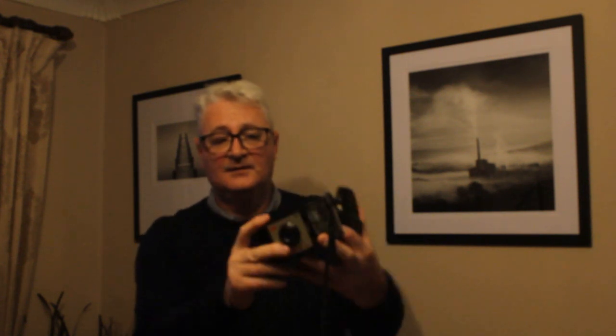There's one little thing that's a bit different with this camera - I have altered it. What I did when I got it was take the lens housing apart. Once I got the lens housing off, I pushed the lens from inside and pushed the lens out, catching the little washer that comes with it. Then I turned the lens round, pushed it back in, put the washer on, and reassembled the lens housing.